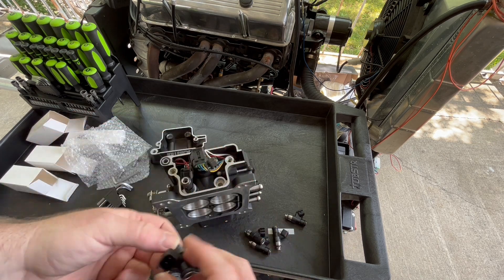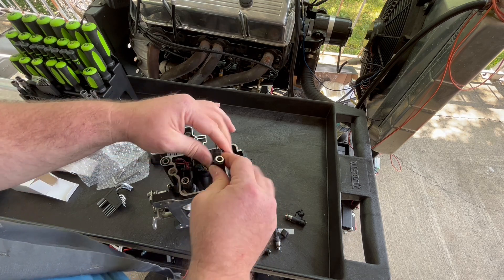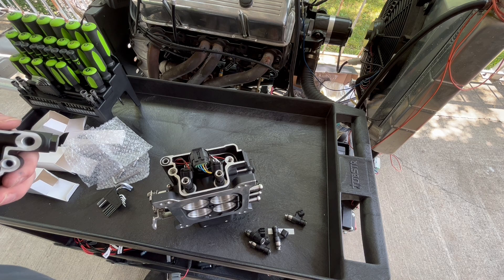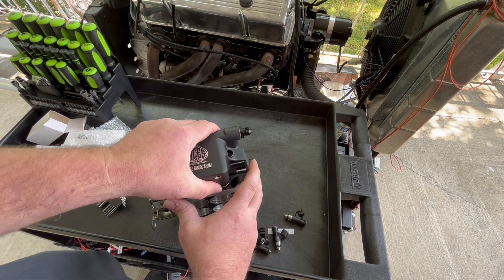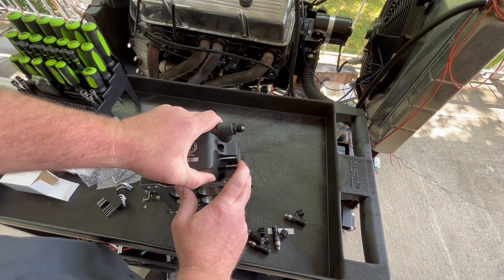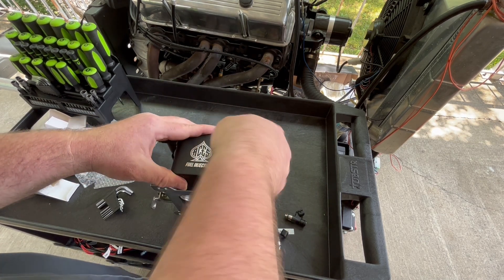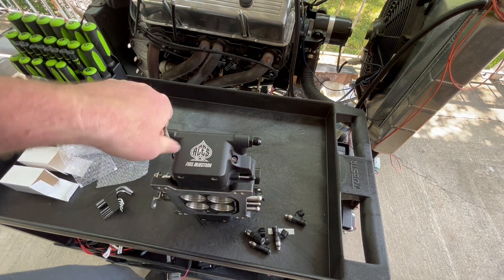Notice that this injector O-ring is a little bit fatter than the other one — it just goes right in and does a great job. Line it up, feel for it, got to kind of massage them in there. Essentially you don't even have to crazy-tighten these things down, you just got to kind of snug them a smidge. Makes it pretty smooth and easy.